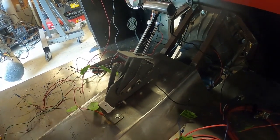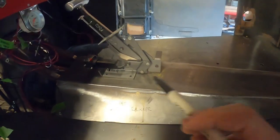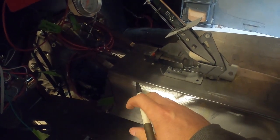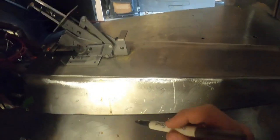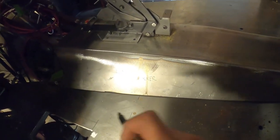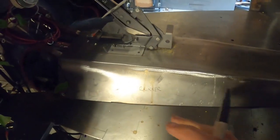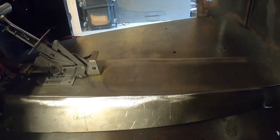Before I remove the shifter, I want to come in here and mark where I want to put some rivets, because that's what I'm going to do - rivet this entire thing. At the bottom we'll silicone it inside and outside. I want to keep this stuff removable just in case I regret it later, so we'll mark all this, drill some holes, and keep everything removable. The rivets should take care of it.